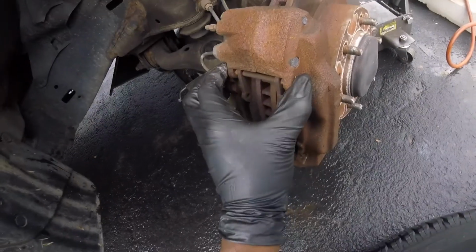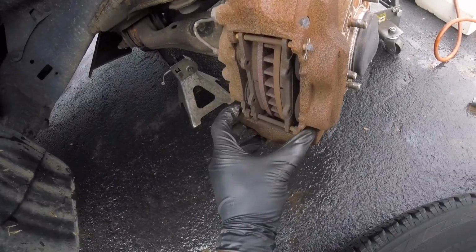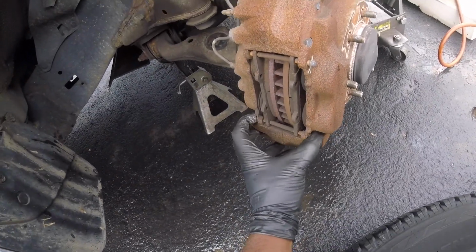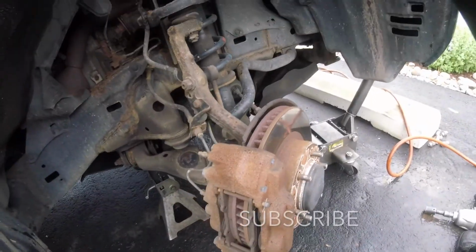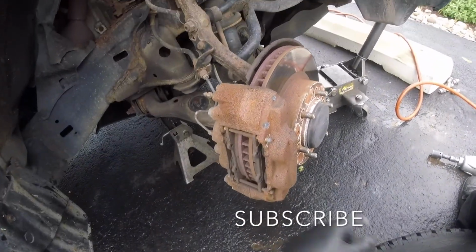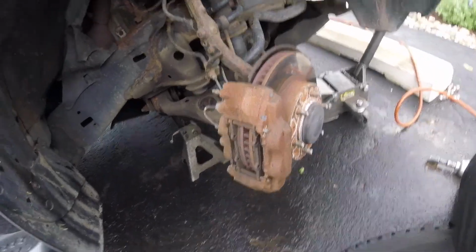Let's see how these guide pins look. Yeah, they're moving pretty good. So hopefully I won't have to fight too much taking them out. Pads are fine. You just want to do them all around. But I'm going to show you guys how to do the front. In the next video I'll show you how to do the rear. So I'll show you what's next.